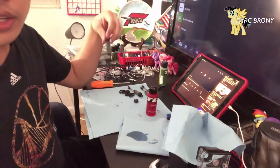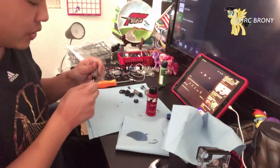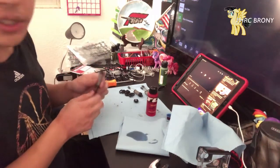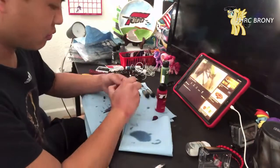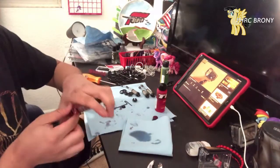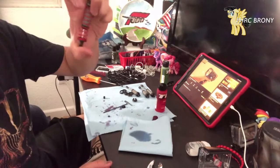Now, what I'm going to do next is just do the same thing. I'm not going to bore you guys with a full-length video of me doing each shock. You guys are going to get bored of that. So I'm going to cut to the chase and go to the top shock. New spring on it too. This is quite stiff, I'll be honest with you. But it definitely works. That 50 weight shock oil is doing its job.